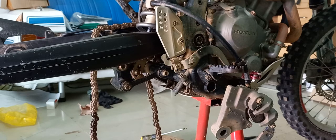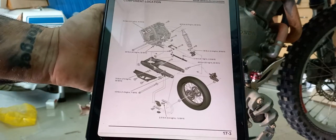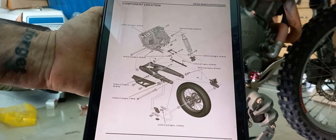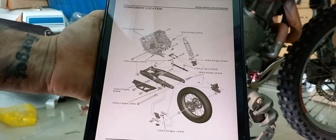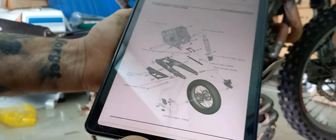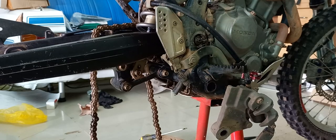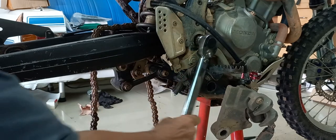What up, people on YouTube. If you've spotted the last couple of videos, we were putting the bearings in. Here is the swinging arm going back in - basically you wiggle the thing in, you put the bolts in. Then go to your downloaded manual, which you can just type in 'PDF CRF workshop manual' and it gives you all the torque settings you need. So with no further ado, let's nail it all back in - arm bolt: 65 foot-pounds.